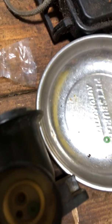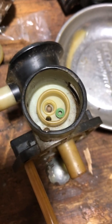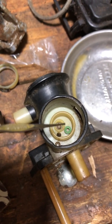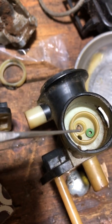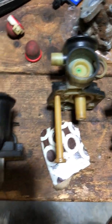There it is, complete. And here is a dirty one that I wanted you to see — that is never going to prime. This may be what's underneath those carburetors that you tossed aside thinking were bad; they might have just been stuck. Now this one would have to be replaced, and I would borrow one from another carburetor that's maybe missing parts, cracked, or broken. But you see how rusty that is — it's supposed to look like that nice shiny round ball bearing. So this will be discarded, then I'll check that needle seat to make sure it's still soft and pliable, and pull out that spring — it's probably going to be in the same condition.